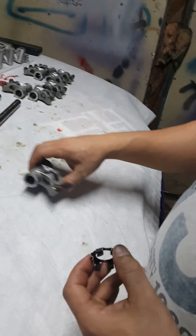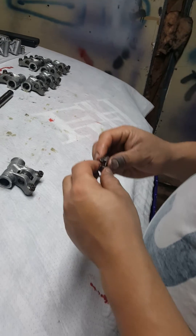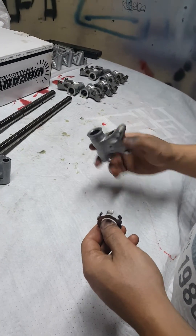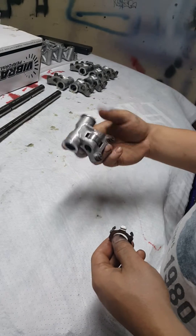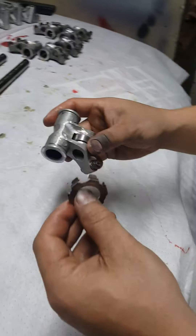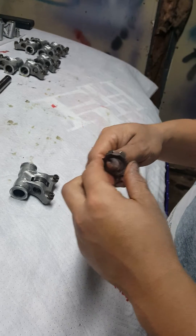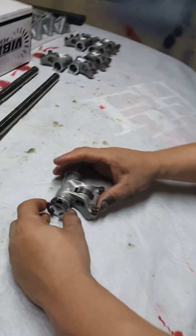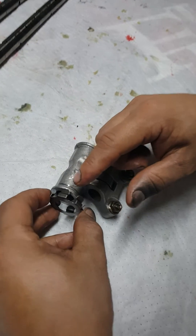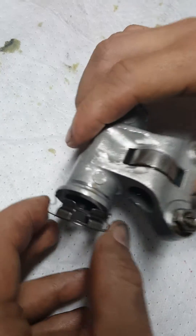This is for you guys doing the V-tech killer setup on your K-series. When you use the K24 A1 rocker arms — which everybody's using — they got these clips that go here. I observed that my cam primary lobe kept touching these clips right here, and what it will do is push down on them and put pressure.